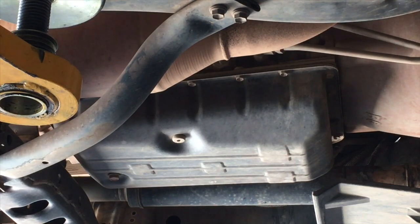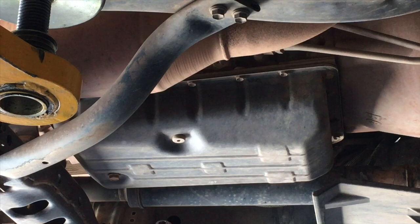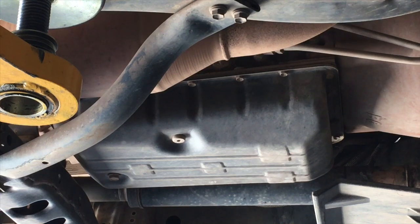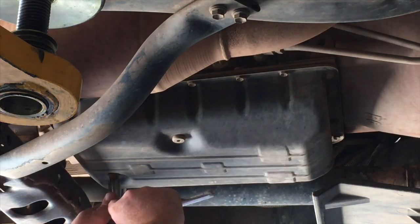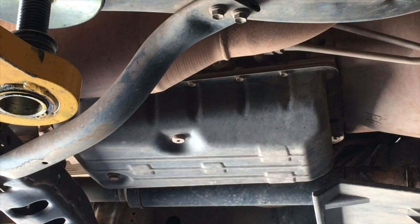I'll confirm — I did use a 24mm. I'll get that filler bolt plug out completely. There it is — it's got an O-ring on it, which is usually in good condition, and you can reuse or replace that, whatever you prefer. The drain plug is a 14mm. That crack was pretty easy because it wasn't over-tightened. And the Allen key for the check level is a 5mm.